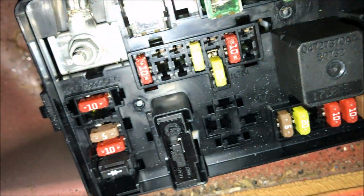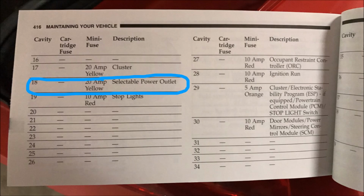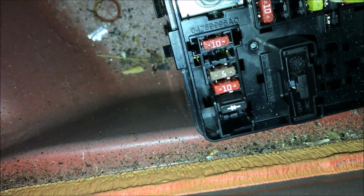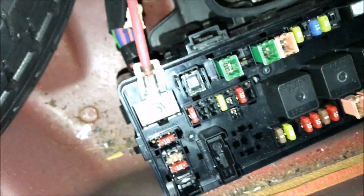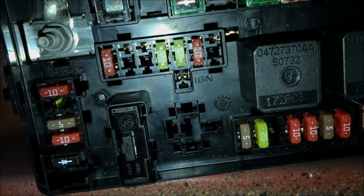If you look at the fuses, you'll see that there's the letters IGN printed near it. Basically this fuse is the one that's offset to all the others. So you want to unplug it and plug it into the first 2 holes so that it's in line with the rest of the fuses in that row. And now your cigarette lighter and the ashtray will be powered on at all times.